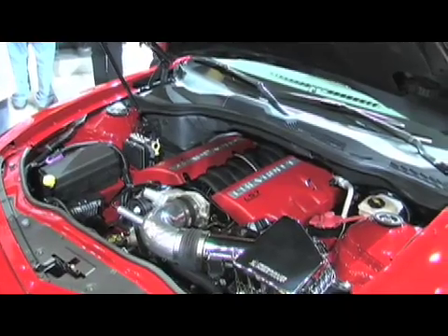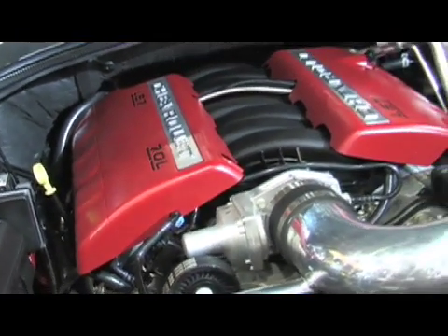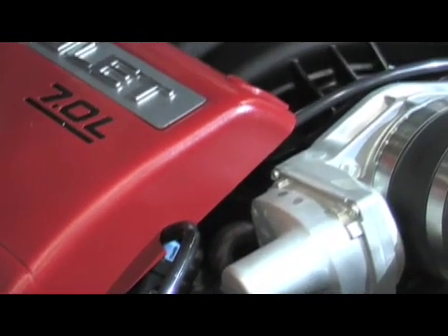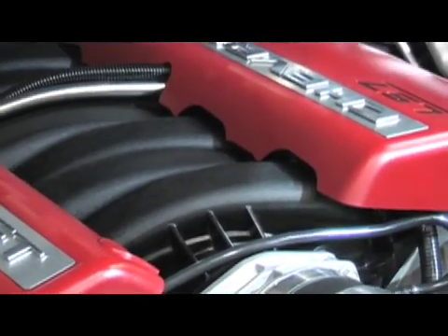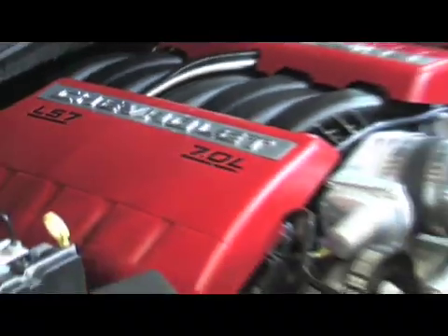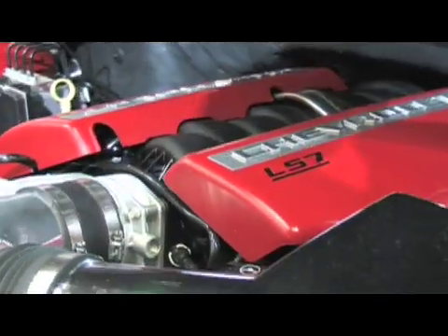No, it's really, really simple. One of the great advantages to all of the LS series of engines is that externally they're identical — the engine mount bosses, the rear bell housing face, the case, all of those things are identical. So the engine literally bolts right back in the car with no changes. The clutch assembly came right off the LS3 and bolts right onto an LS7. They upgraded to an LS7 clutch, but the throwout bearing works, the transmission works — no changes there at all. All the engine mounts bolted back on. The front accessory drive, alternator, power steering pump, and AC compressor all bolt right back on as well.